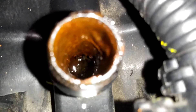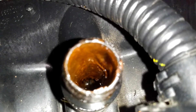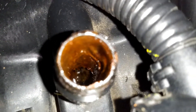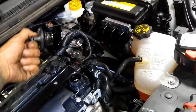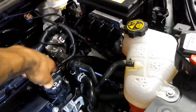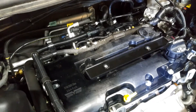I cleaned it out and you're supposed to see a little pink nipple that sits right about there. You should actually be able to see through it — but mine doesn't pass. To confirm the chirping sound, one way is to take off this valve cover or open the oil fill cap — the squeak will actually go away, and you can kind of hear the chirp coming out from there. That confirms it.